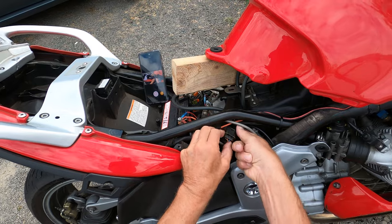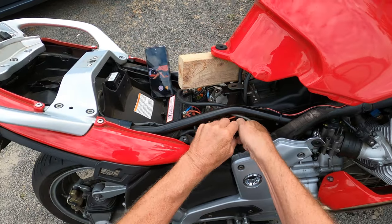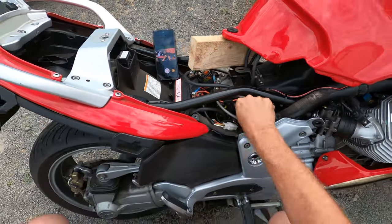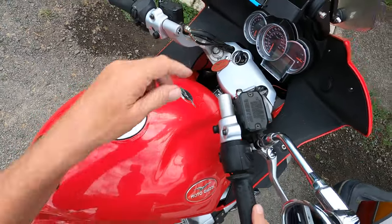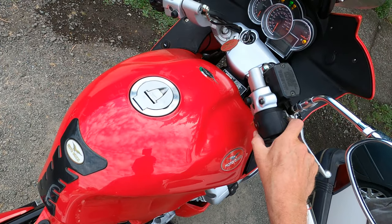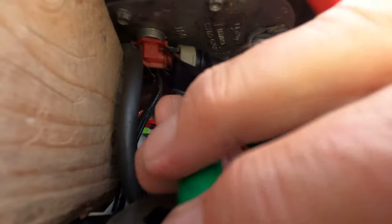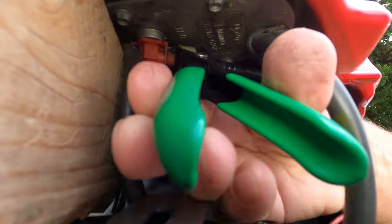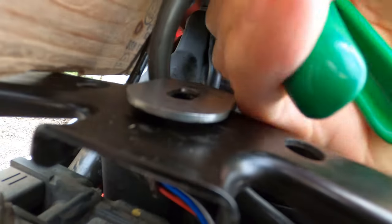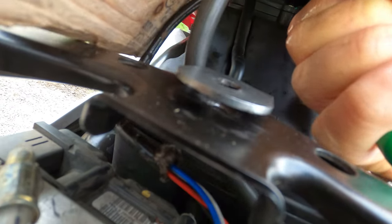You've gotten your fuel tank out of the way, which is pretty easy. I saw on YouTube a trick where you pull the power going to the tank to kill the fuel pump inside the tank, then crank the motor to relieve pressure in the line — it might help getting the most difficult connector I've ever encountered apart. I revisited this connector three times by hand and was never able to get it apart. Found the tool, ordered a three-pack of special hose tools, and it actually does help remove that connector.